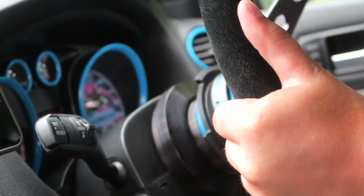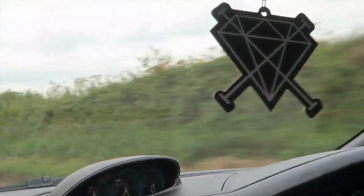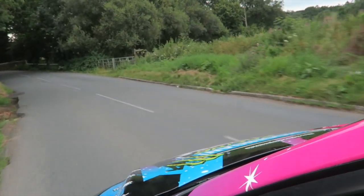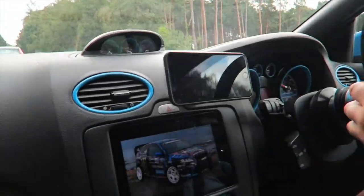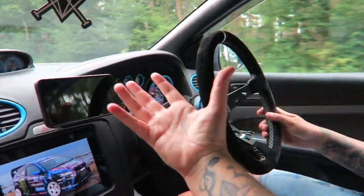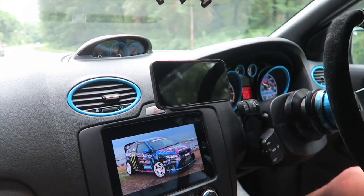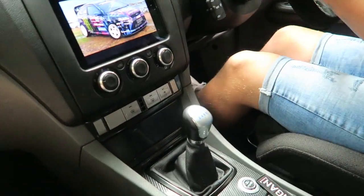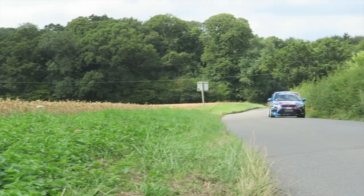The material feels a lot nicer. I had my list of what I wanted, gave it to him a few days later, said can you put that in? And they said that's probably one of the best things you could have done to actually put that power — 412 brake horsepower going through the front wheels — in one of these Focuses. There's a lot of time and effort gone into that power, so you want to make sure it's actually correlating to complete stability. And there's no real traction loss through the drivetrain — it actually hooks and goes, which is a lot to be said for putting an LSD in one of these. It actually transforms the car from being a one-tyre-fire moment all the way to being able to actually put its power to the ground. You can still turn the traction off and it will still light it up — both wheels will go — but it actually works with the traction control.